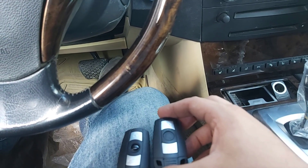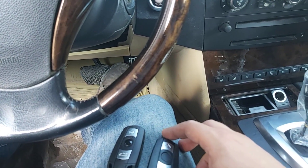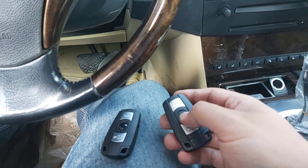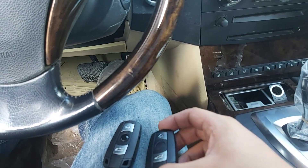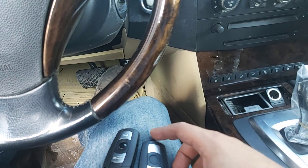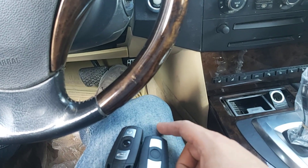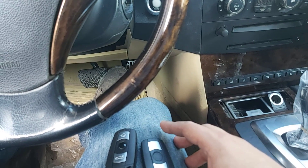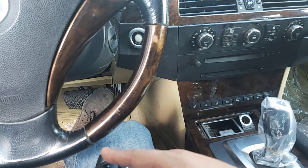After the CGDI downgrade, the keyless go proximity functions had some problems. I then went with VVDI2 but couldn't repair the keyless function for that key. So I updated the CAS with WinKFP using ICOM and connected again with VVDI2 to repair the keyless functions.